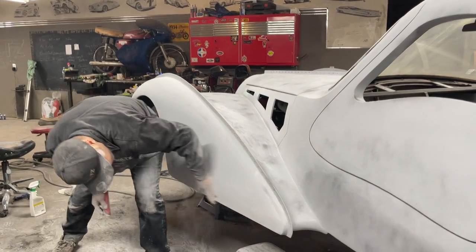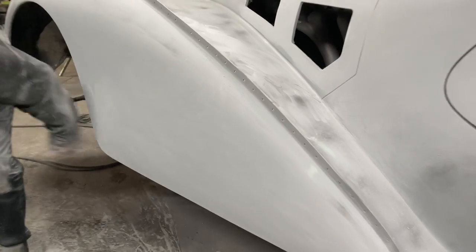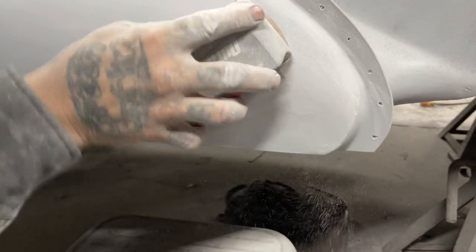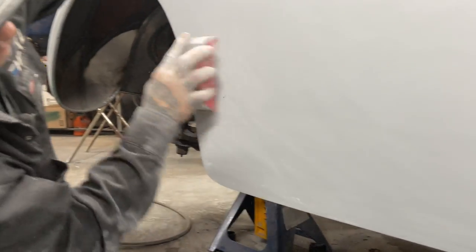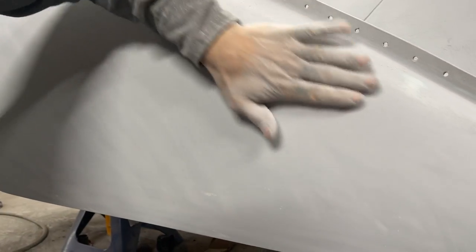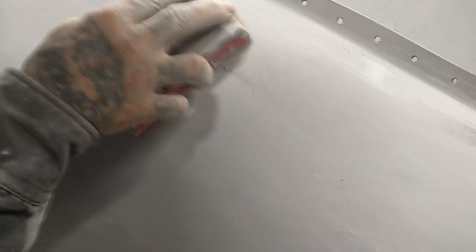You can see that there, baby, if you want to come over and take a look. Okay, on this panel, as I'm sanding this with 220, let's take a look at it. I see over back here, well, pinhole. Got to fix those. So I'll have to come back in and get those. Right? Don't see any scratches. I don't see any black spots where the guide coat's on. Oh, look, a couple little black spots there. Give that a swipe.